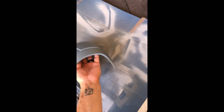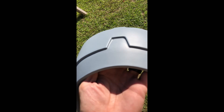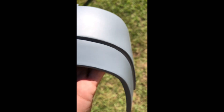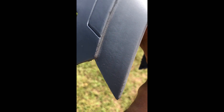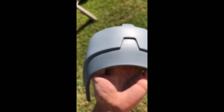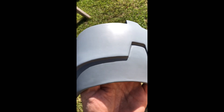As far as these pieces go, this is really with no sanding — this was just the glazing putty and then two layers of filler primer. I haven't even really sanded this one yet and it already looks pretty good. There are obviously some imperfections, but overall they're looking pretty good. You've got to repeat that process a couple times. Don't sleep on that glazing putty — it'll easily save you three or four rounds of filler primer and sanding. Use the glazing putty first, then use filler primer for very minor imperfections. This one I'll sand with 320, hit it with two more coats of filler primer then 400, one more coat then 600, and it should be good.